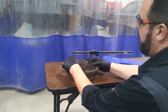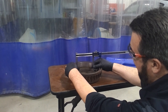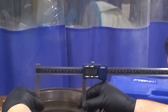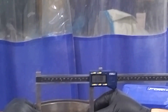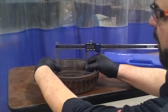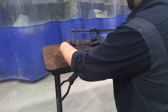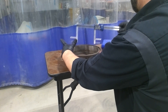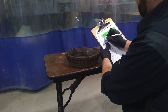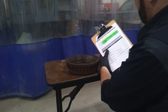Once you do that, I like to grab both arms of the tool and wiggle it back and forth a little bit to see if I can get a maximum diameter. On this one, I've got 8.909, 8.910. So that's what we're looking for on this drum — 8.910, and that's in inches, 8 inches and 910 thousandths. Once we get that measurement, I'm going to write it down: 8.910 on an inch.